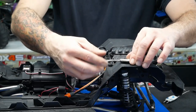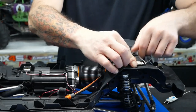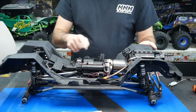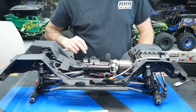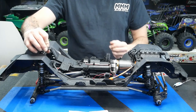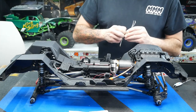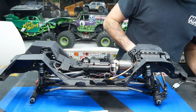For this light here, we'll have the power enter here, come out this side, and then these wires gotta run back down to the middle light underneath, and then back up to this light, and then out from this light, back to this light, and then underneath to the middle one, and then back up to that side and terminate. And we'll leave the pigtail on the end, just sticking out, cut off in case we want to add any more lights to the system. Don't think we'll need any more with the amount of firepower these things put out, but yeah. So let's get cracking on that.